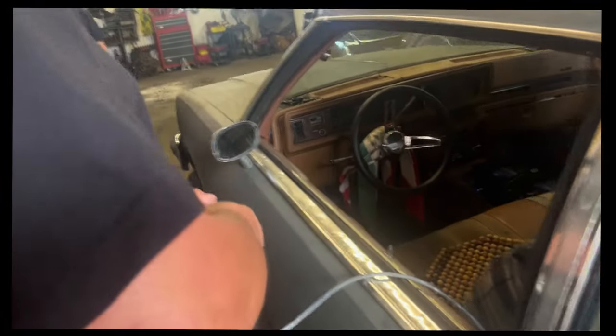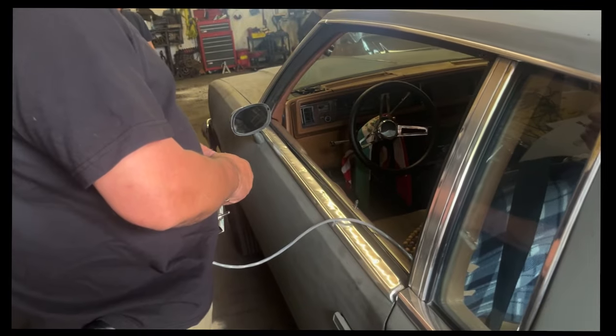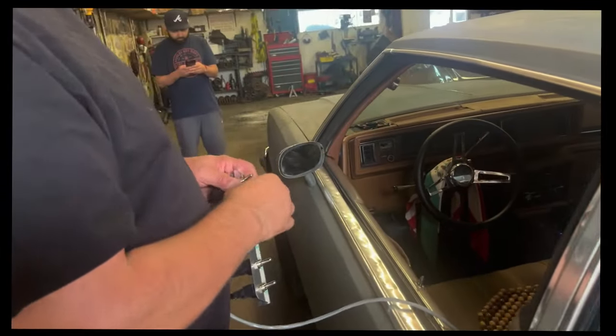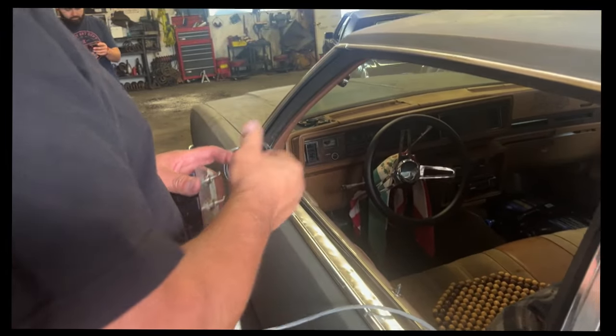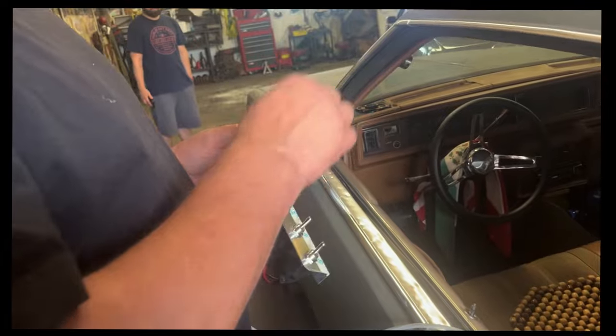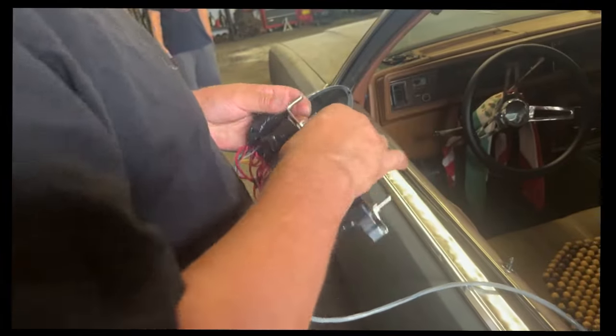So this is the highest it would be, right? Yeah. Okay, that works. There's so many different things you can do. But you see how that, you hear that, the arms hit the frame? It's literally about that much more to where it's locked out. But you really gotta feel the switch. If you over hit that, you're going to break a pump head. And that means the pump has to come out and be disassembled to put in a new pump head.